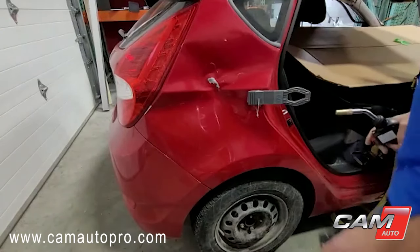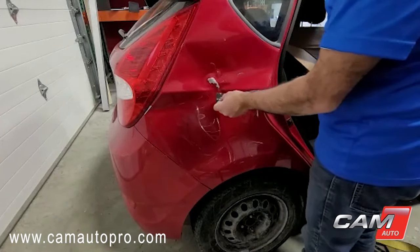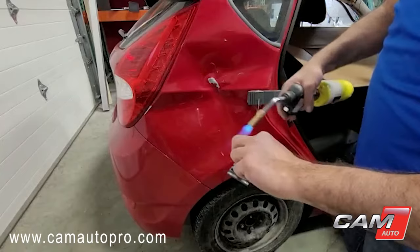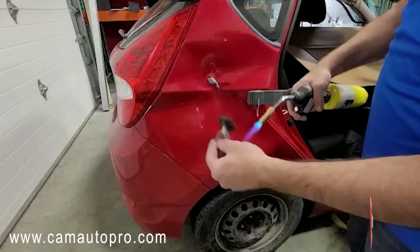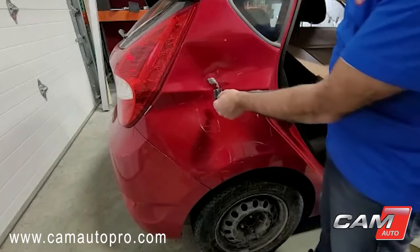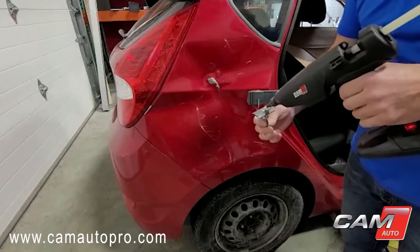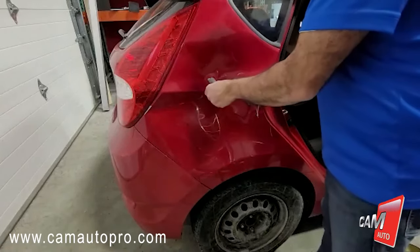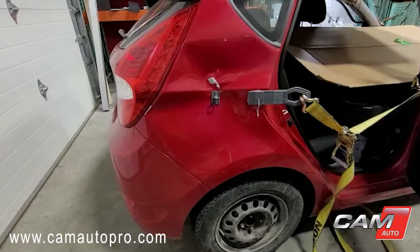Now I have to wait three minutes. When I pull that way I don't need a big tab here to pull the dent out, so the small 3D tab will be good. I'm gonna heat it just because I need to bend it a little bit this way so it takes exactly the shape I want. So this bends the tab — and it fit perfect. Now we are ready to pull.